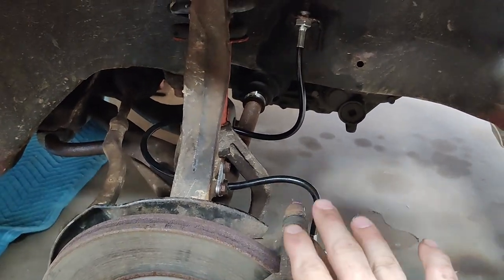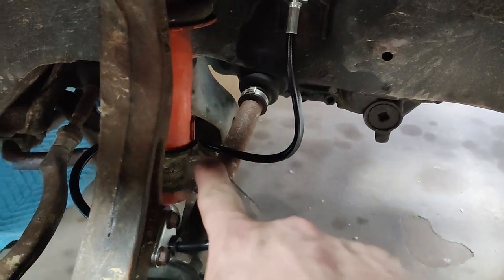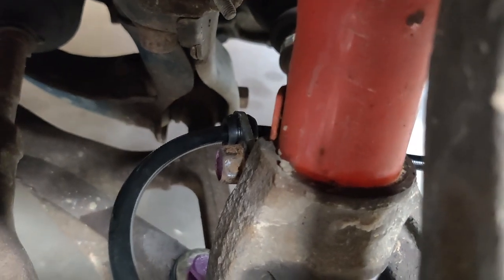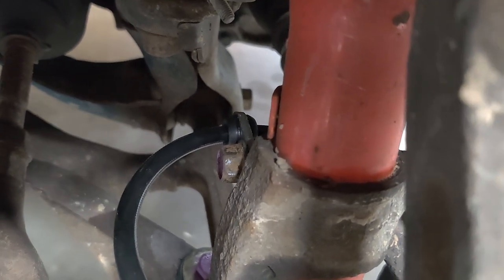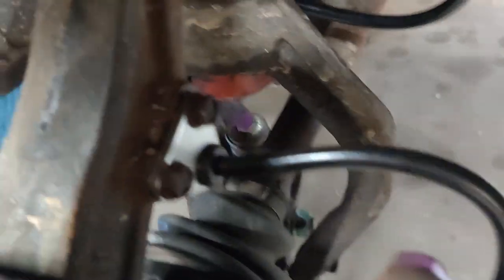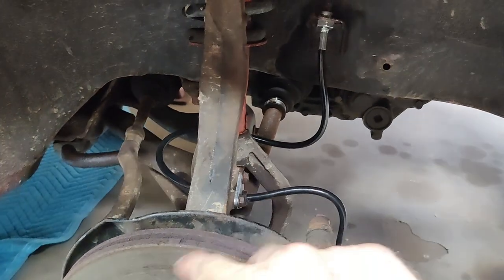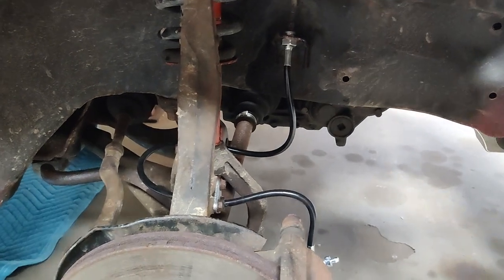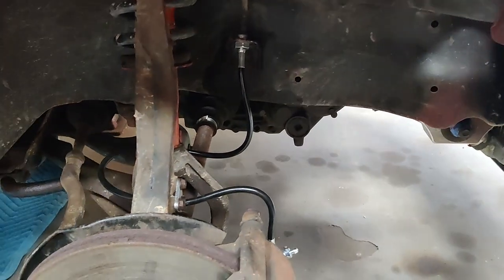What I did — I don't know if this was their intention with the kit — is I ran the line behind the fork and used the shock bolt to attach that tab to the fork. I did have to take a step bit and drill out that hole to make it bigger, but it works. Then I brought the line forward, through that tab, and it mounts to the caliper. I don't think that's how they intended it, but that's my thought process and I think it's what's going to work best, giving everything plenty of play while keeping it secured.